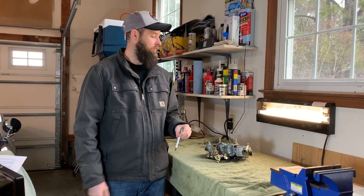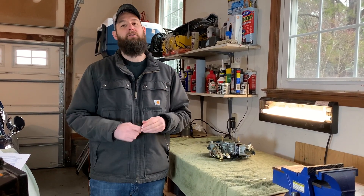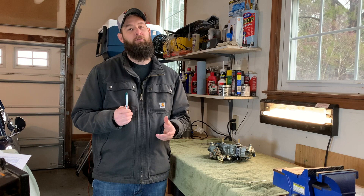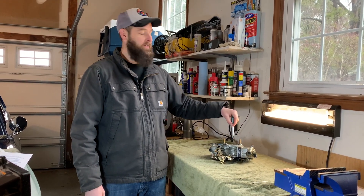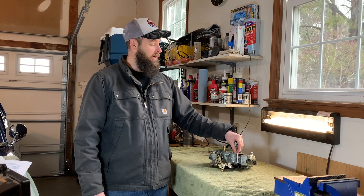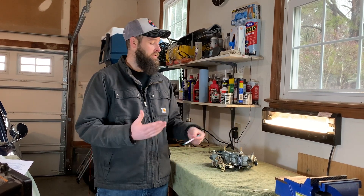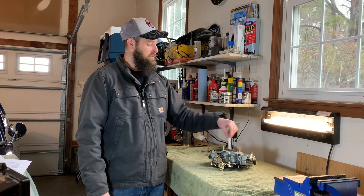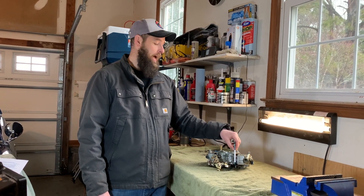Getting everything back ready to go for the racing season — you got to clean all this up. This is a carburetor off the Nova. Number one, you got two types of carburetors commonly used in bracket racing setups: the Holley 4150 and the Holley 4500. The 4500 is what you hear referred to as a Dominator. The Dominator's overall main body will be larger than a 4150, which accommodates larger Venturis, larger throttle blades, giving you larger CFM. The base plate will also be different, so you'll need a different intake to accommodate a 4500 or 4150 — whichever you choose. The intake needs to match up because your bolt pattern will differ due to the base plate size. Some intakes can accommodate both, but you want to check that to make sure.